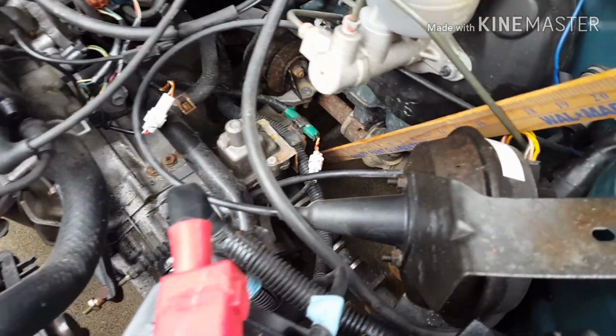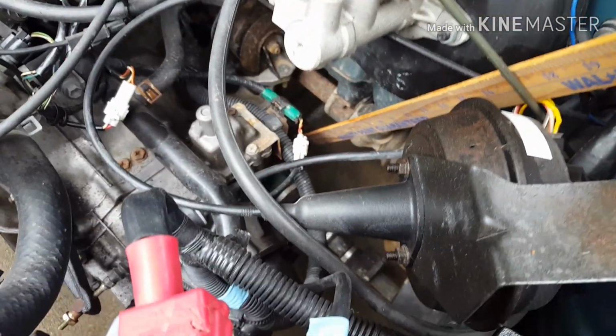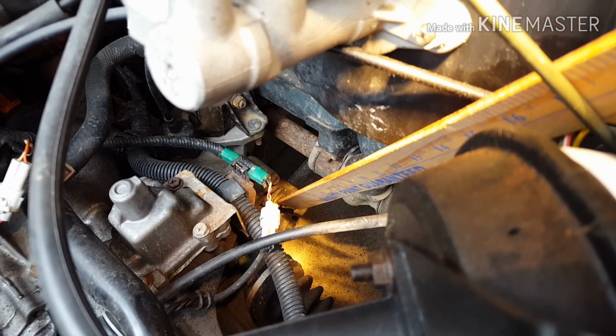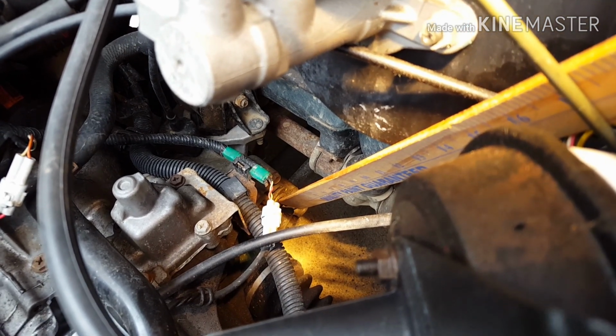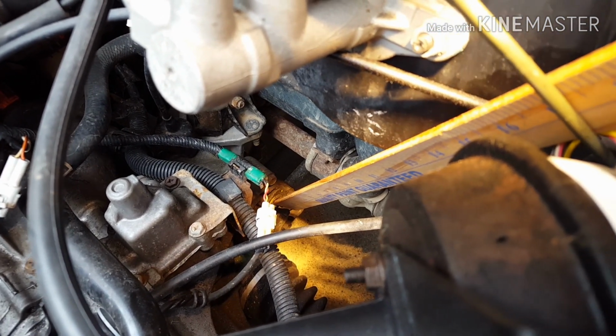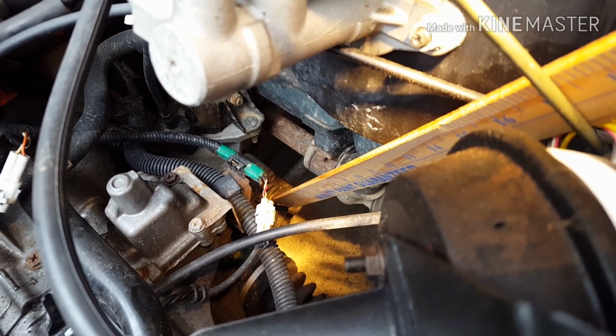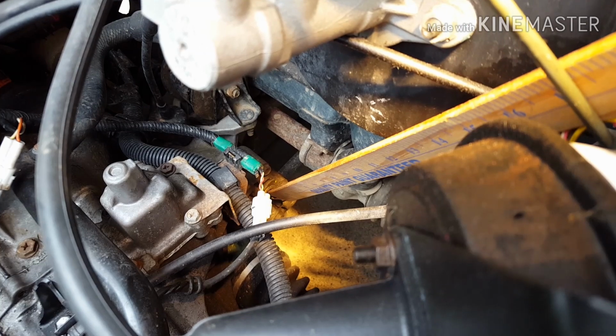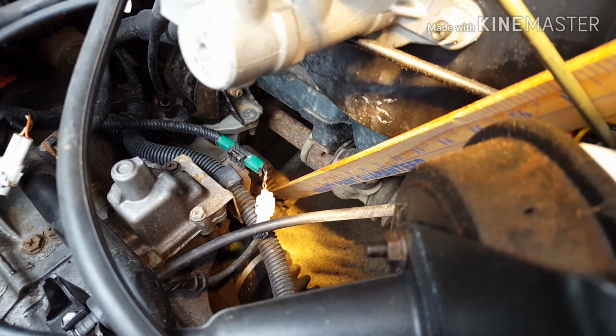For this, this yardstick is sitting on the end of the spout down there. I don't know if you can see it. It's a little doodad on the side of the transmission that you put a ratchet on and twist off, and that's your level. That's the sight level for it. But it's kind of a pain in the rear to do that, especially if it's a little high and may start leaking all over your driveway if you don't have a drain pan handy.